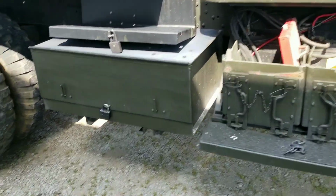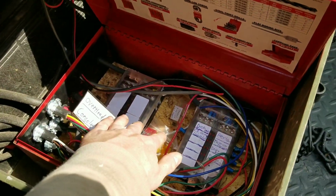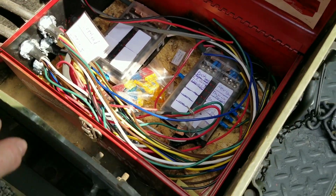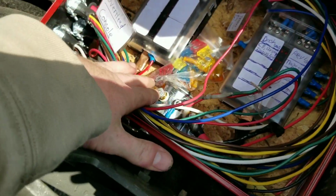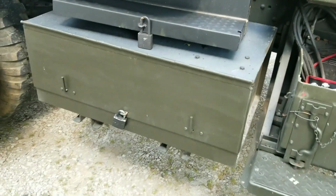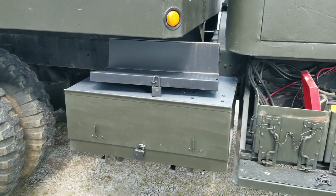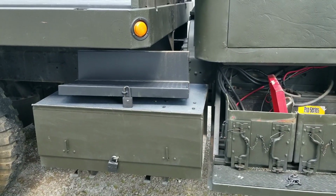So another thing I thought I'd show is I put two fuse boxes here. One is for 12 volt right here, one is for 24 volt. They're both switched, but one is on a solenoid to go to the 12 volt for the first battery in series. People say that'll cause an imbalance and all this, and I mean, unless you're running a 1500 watt heater, it's not going to matter that much. These batteries are pretty old and they've done well.